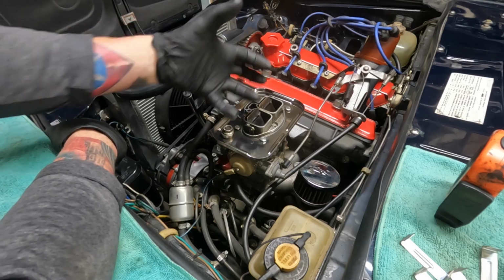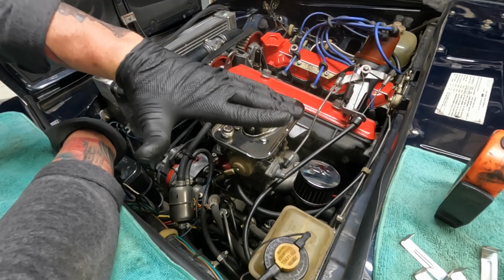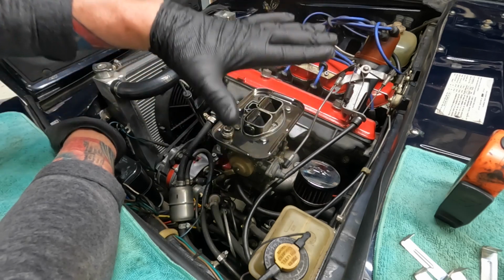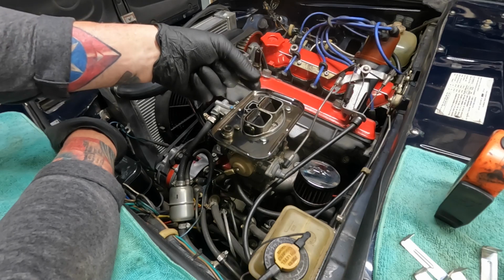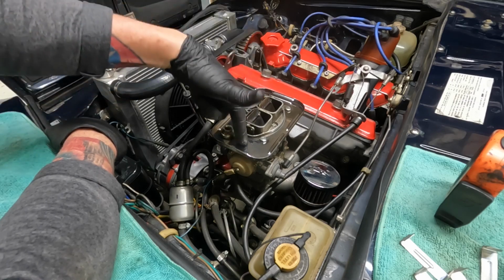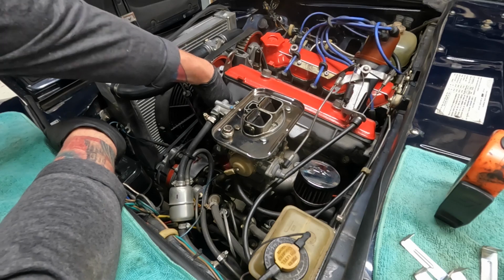This thing vibrates. Okay? You got multiple sets of gasket materials between plastic plates, metal plates, all kinds of plates. It's gonna swell and contract with the heat cycles of the motor. So it's gonna need to be retightened. Retighten this, retighten your intake manifold.